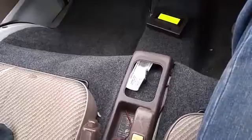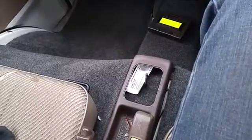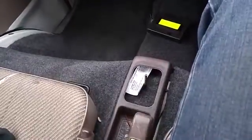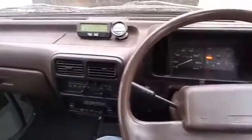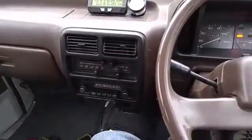And low. Low engages the front drive shaft, but in order to engage four-wheel drive, you need to connect the front axle. So there's a lever on the front axle, which is normally vacuum operated. You need to move it manually because there's no vacuum system on the truck. But with all the weight over the batteries, or the weight over the rear wheels of the battery pack, I've almost never used four-wheel drive.